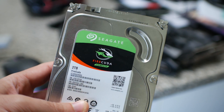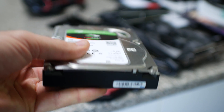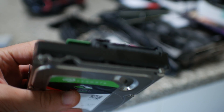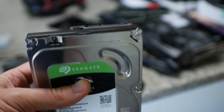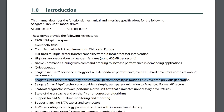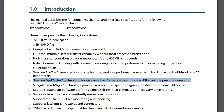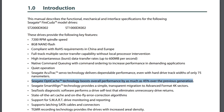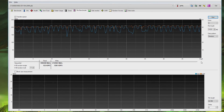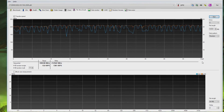This drive, as mentioned before, performed really well when loading up games after the second load. Seagate's claims that this SSHD has new learning algorithms that help with performance seem to be quite true. Cold boots were still quite slow even after the third attempt. However, performance like the Barracudas was really consistent in both read and writes, so this drive just like the previous gets the nod of approval.